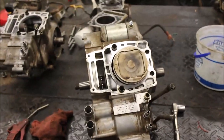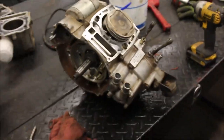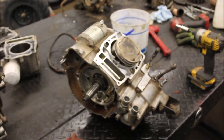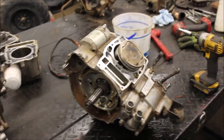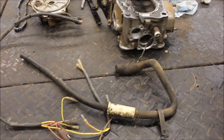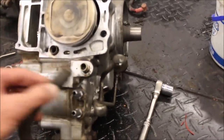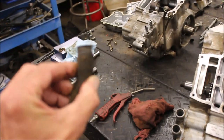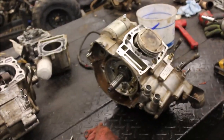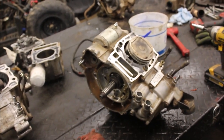I've got a good 500 motor here — the piston's good, clean as a whistle. The piston rings, piston, and cylinder all look good. Here's the reason why it ran like crap: you've seen my older videos about replacing rubber fuel lines and vent lines. This is the rubber vent line that goes on the engine — it was soft, it folded over, it probably collapsed and made the motor run like crap. Bonus for me because this motor is in excellent condition, so I'm just going to hone out the jug and rebuild it.